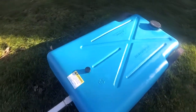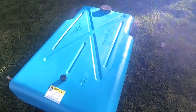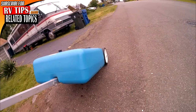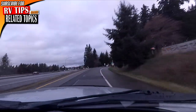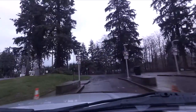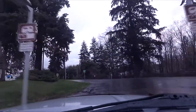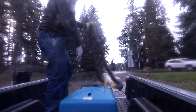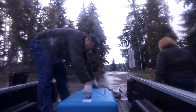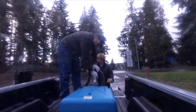If you can't find the same spot for long periods of time without sewer hookups, you may find it necessary to take advantage of a portable RV waste tank. These tanks allow you to empty the contents of your black water and gray water tanks into an external tank, which can be transported to a dump station. RV portable waste tanks usually have wheels and a handle, so they can easily be pulled from the campground or loaded into a truck for dumping.